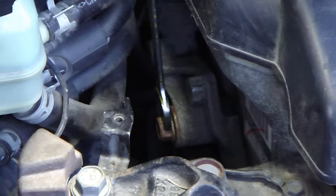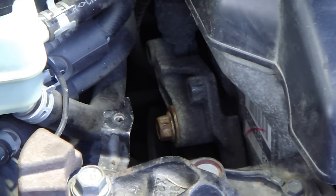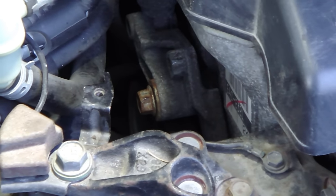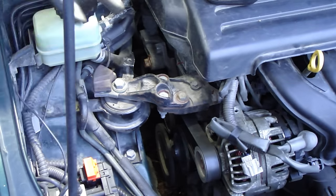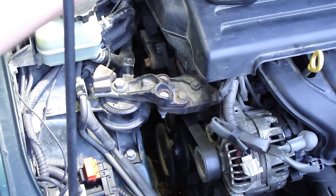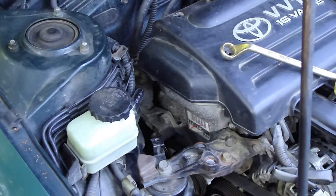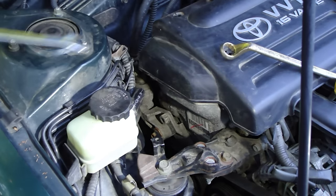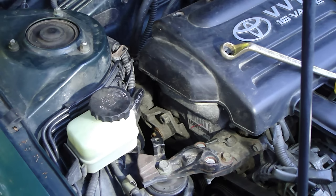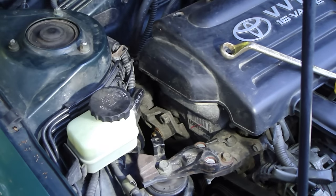And by the way, this VVT-i engine's belt tensioning system is automatic. That is, it automatically tensions this belt, and this system is over in here. Maybe now you can see that there is this system. It is just in here. This system is an automatic detecting system. Okay, and now I tighten this bolt. Okay, and when this bolt is tightened, then we start the engine.